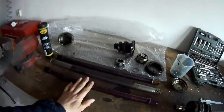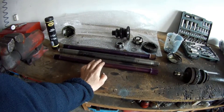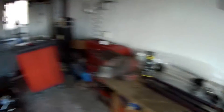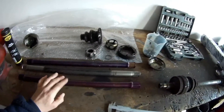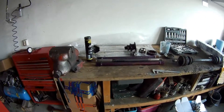These axles are 60 millimeters shorter. The benefit is I have an automatic transmission behind this car, which is easier on your axles. But these are also used in race classes. It's a pretty fat axle — 39 millimeters. Underneath a V12 it's 32 millimeters, but he says these Mercedes axles are very hard and not very flexible. I really trust this guy — he knows what he's doing. If you look at the quality, it's very nice. Have a look at his website; I will put a link below the video.